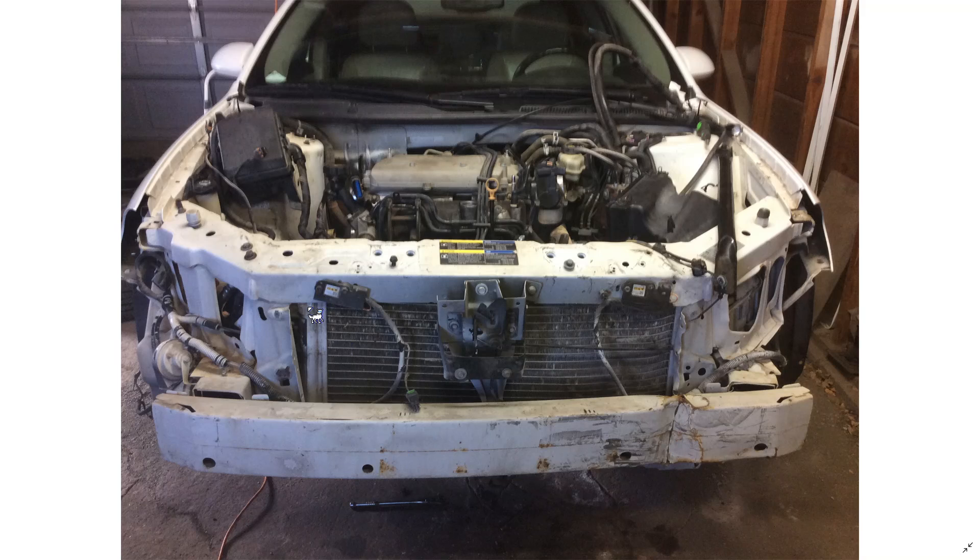The person that owns this car — the person before had an accident with a pole. They hit this pole pretty hard, because they bent the whole framing for the radiator and AC condenser. They tried to straighten it — obviously by this being pulled forward and down. They probably had it hooked to the floor. Some shops will hook the car to the floor and straighten out frames. But this bar was never attached — it doesn't line up with the two holes, it just flopped around ever since they had it.